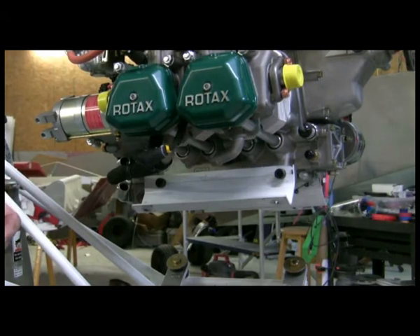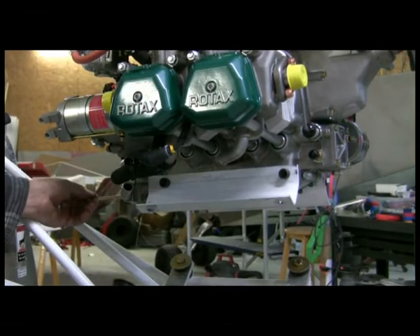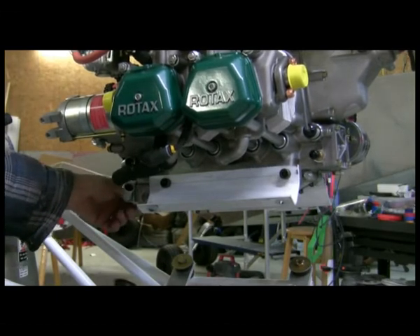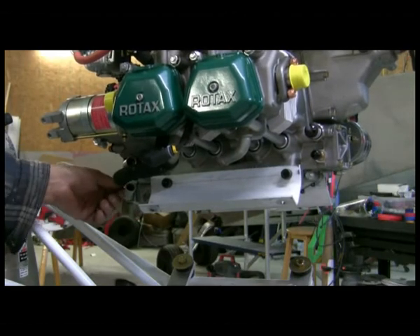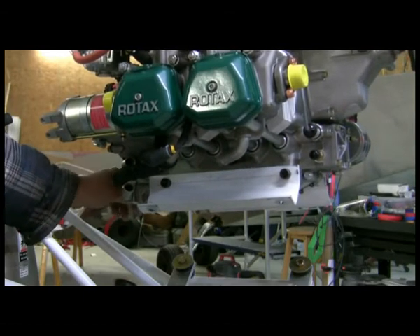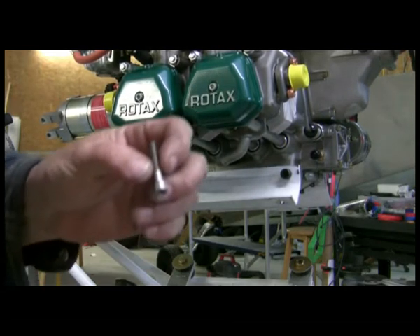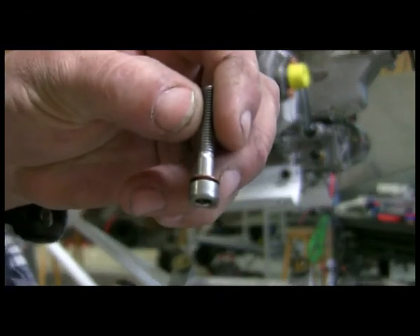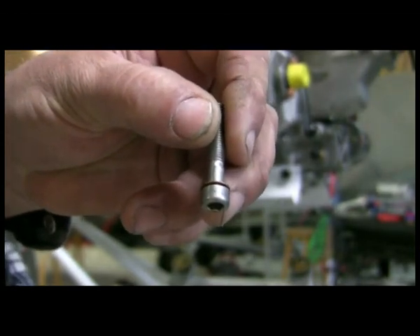But just because we're not installing new lock washers, we're just going to use just a touch of the blue Loctite while reinstalling here. The lock washers are still in pretty good shape, but this will just reassure that we're going to be nice and firm in here. And always remember that the one with the copper washer is at the very bottom — it needs this extra soft washer in order to retain a really good seal.